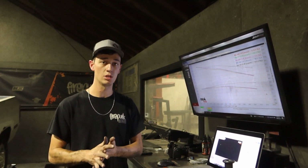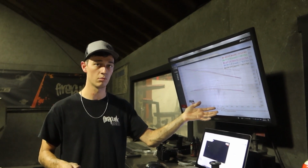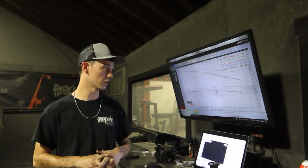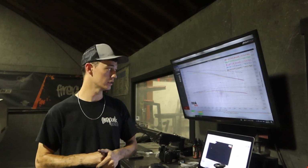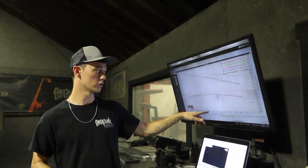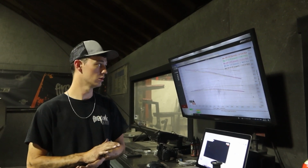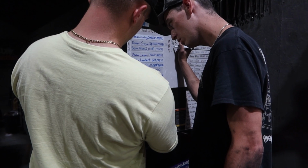I think we might've changed the start and end speed of the run because we're running at 3,100 RPM. And I've been running mine out farther and it's still holding power out where he is. Granted, peak moved from 2400 to 26, 27, so we're moving in the right direction. I believe that's kind of where we want to be, but we will see. But bump timing, we're going to run it again with KSB on now because now we know where it needs to be. So let's do it. Run!